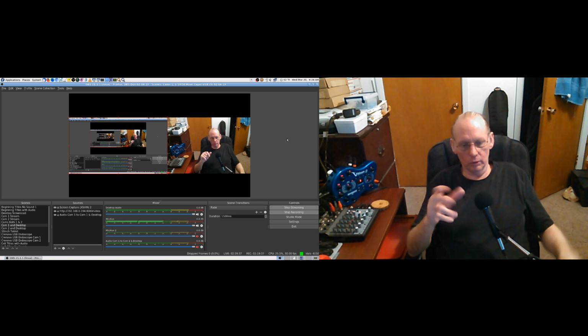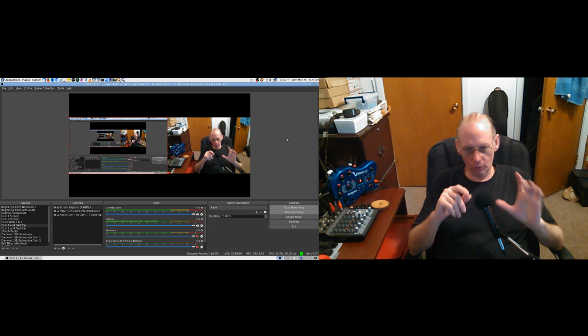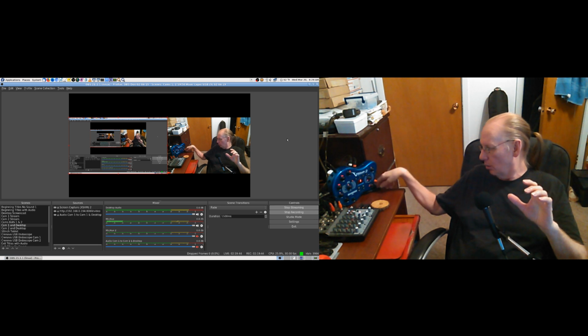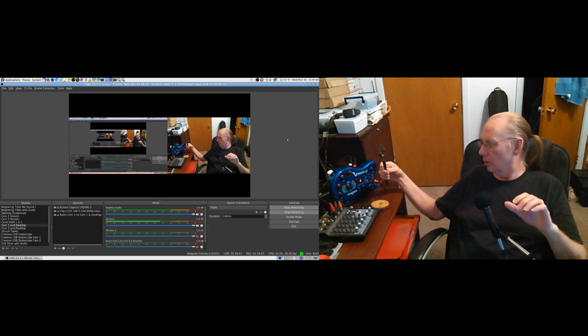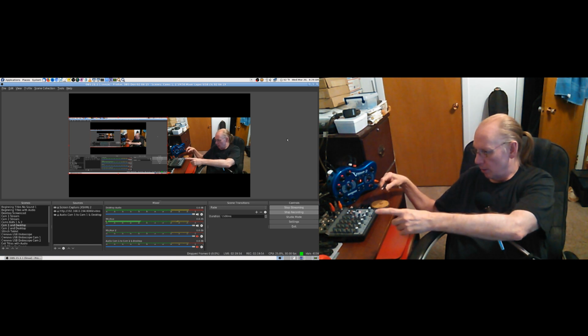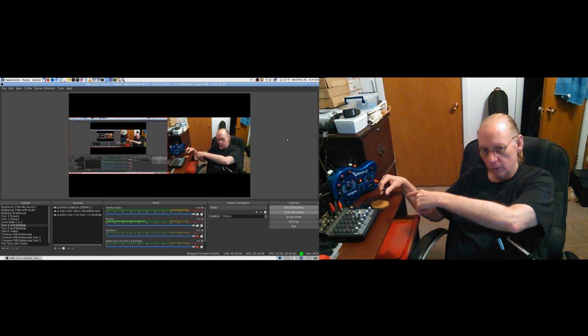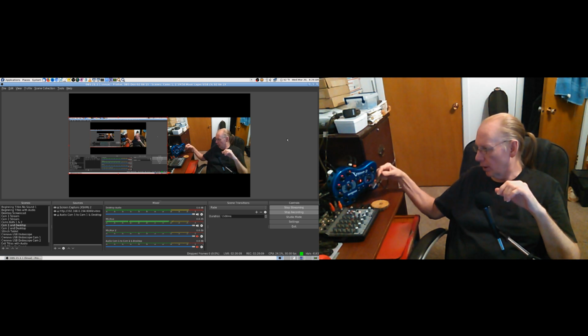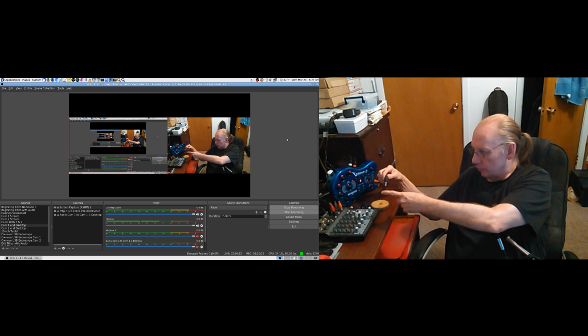So if you're going to have to go from a quarter inch, like from a pro style cable like these, to 3.5 millimeter, you should either make or buy a little adapter cable, maybe a foot long would be good. Female TRS on this end, and then a male 3.5 millimeter on this end. It can be right angle or straight, it doesn't really matter, as long as it's a nice soft cable and not this whole thing hanging out the back of your computer with another 1.5 or 2 inches on top of that.